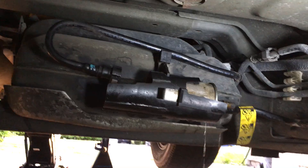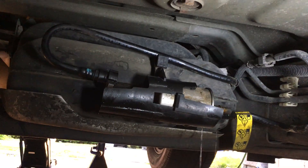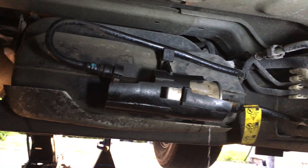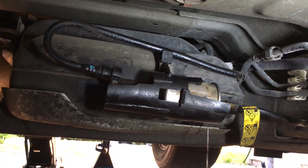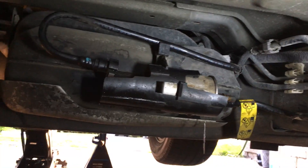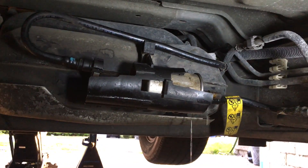Just wanted to give a couple of tips on how to remove a fuel filter. This vehicle is a 2005 GMC Canyon. First, remove the gas cap to let air into the system — just leave it sitting loose to let air into the gas cap and into the fuel tank.